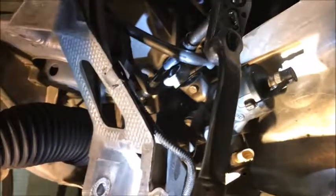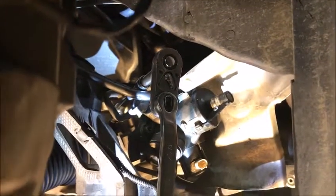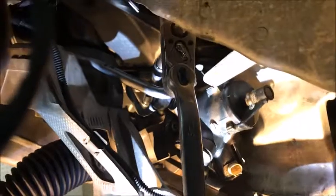We got up in here — one line is loose now but it still won't lower down, and the reason why is that line way back there where that socket is. There's a little 10 millimeter nut that attaches a bracket for this line. I thought I'd add that because it took me a few minutes to figure out why it still wasn't lowering down. There's a little bracket back there so you've got to take that nut loose — you'll see it once you're looking. Right at the end of the socket there's a little 10 millimeter nut on a bracket, and that bracket attaches to that pipe. Take that loose and then that should free this pipe up.